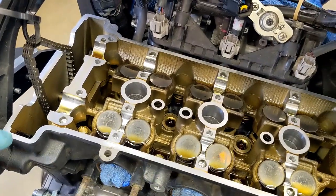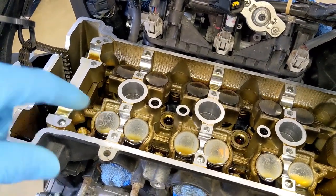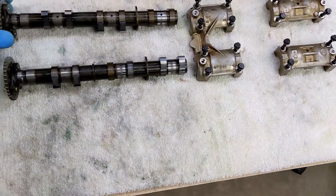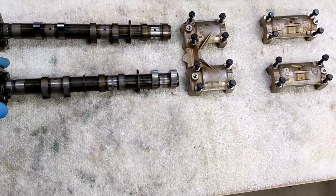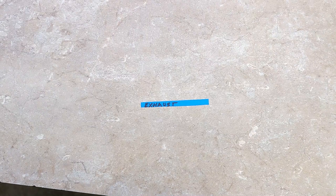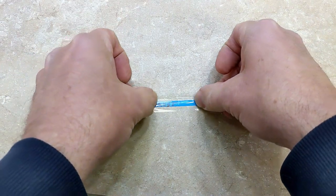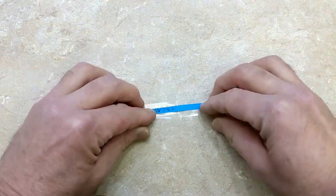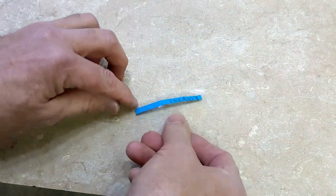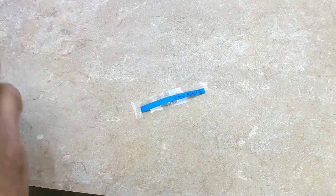So on the next video, we're going to remove the buckets and the shims underneath. So I laid everything out so I can remember that this is the intake here and this is the exhaust. So I could see how it'd be really easy to get these confused. So I'm just taking a piece of tape and I'm going to make a little label. The reason I'm coating it in tape is because it's going to get coated with oil.